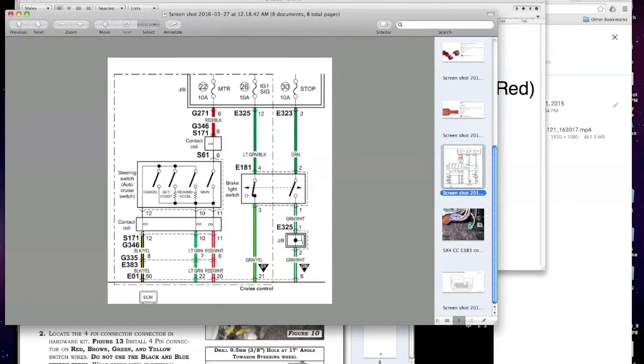Over here, right, here's the E383 connector, 383. So right here you're going to have those 110 females, and they're just going to slide into this green connector. Okay, so notice that this one's going to be in the middle, and what I did on this middle one, and you'll see it in the picture and maybe the video, is I put shrink tubing around the actual spade connector.